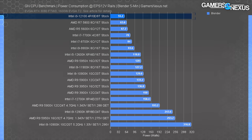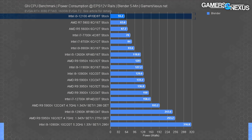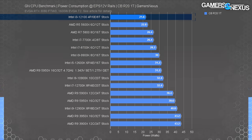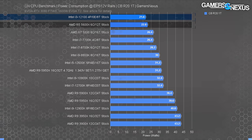Finally, a look at power consumption. The i3-12100F under a full all-core workload, measured after tau at 5 minutes, requires 55W steady. Considering its Blender performance is unexciting, that marks the 5600X as far more efficient for the same work. In our one-thread Cinebench benchmark, the 12100F pulled 22W for a single-core workload, including VRM efficiency losses — the lowest power consumption for an individual core we've yet tested, with the 5600X basically within error. At worst, they're tied for the lowest.